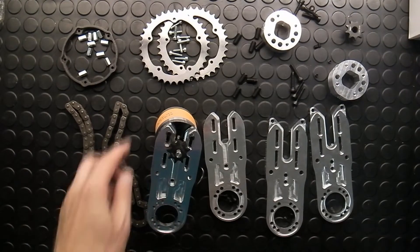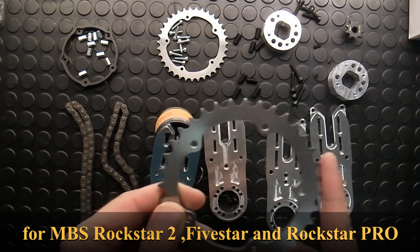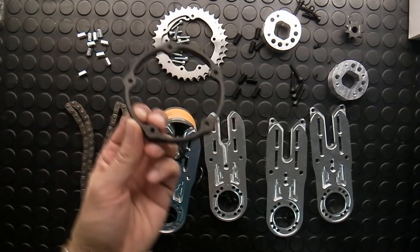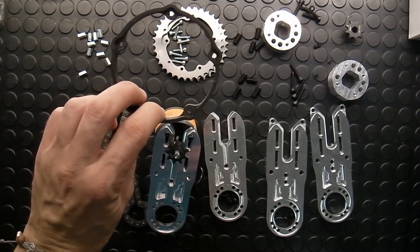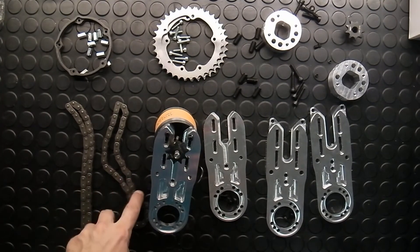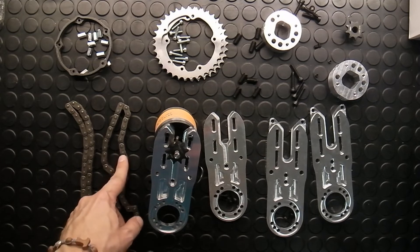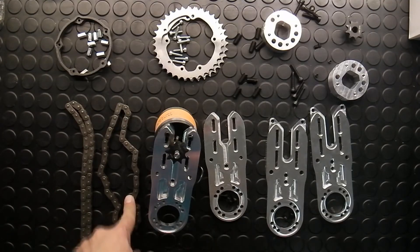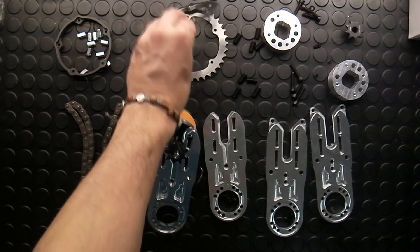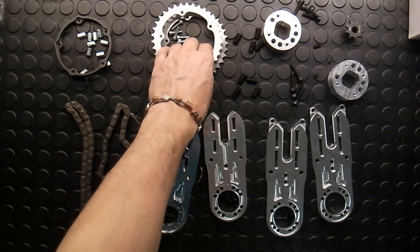This is for Matrix 2, and this one is for Rockstar 2, 5-star, and Rockstar Pro. Just the washers need to be changed, so based on your needs I will also give you the right spacers. By the way, this is developed to have optimal wear — that's the reason why the ratio is 9:35 and 44 segments for the chain, because this is a really great setup for the optimum wear of the complete system. This is also the minimum dimension for the hubs of the MBs you can use, so this is a lightweight system.